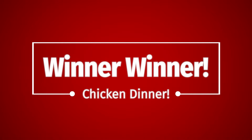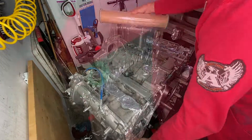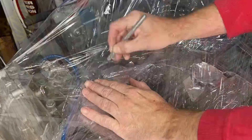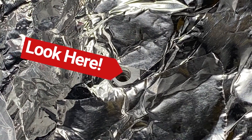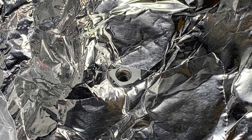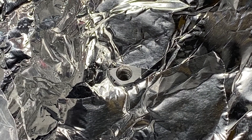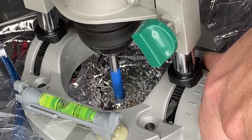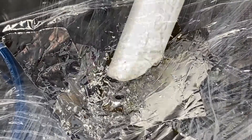Decision time. I think from my little experiment here the Time-Sert is the one I want to go with. I'm not messing around with these metal shavings — I'm wrapping this thing up like E.T. That metalized duct tape is very handy here. Those are the threads that are ripped out at the very top — there's not enough there to work with, so step one is get rid of everything that's in there. That drill bit was much better than the Black and Decker drill bit, whatever magic is in that thing.